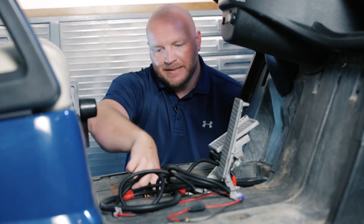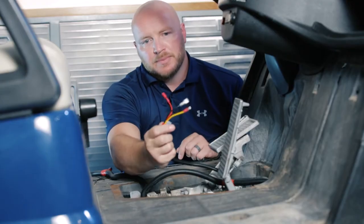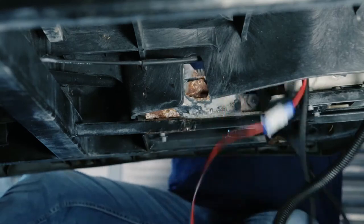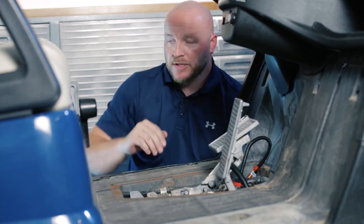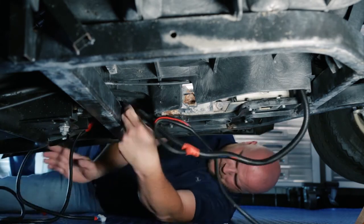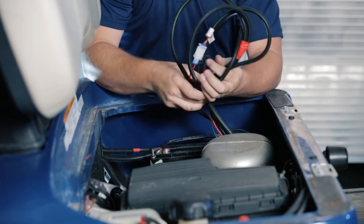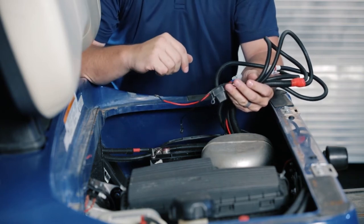Now we're going to take our harness and feed it back in under the cart through the cavity here. Remember, we're going to leave our brake switch hookups in the access. Now the reason we did this was to get the harness up over the front of the frame. Now we're going to run it to our battery pack. We're going to feed our harness over the middle part of the frame here in through the cavity. At this point, we can feed the back side of our harness into the engine compartment or your battery compartment. You should have your tail lights and your battery hookups — we're just going to leave these aside for now. We'll come back later.